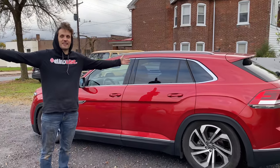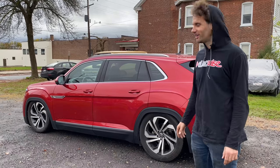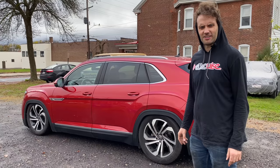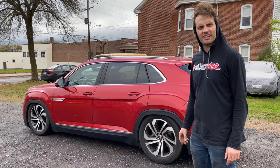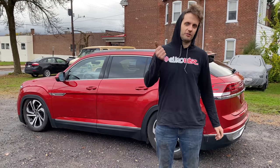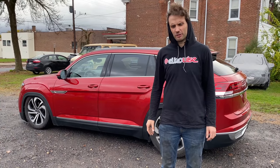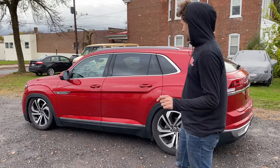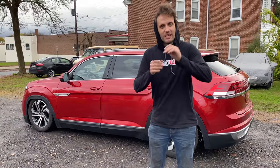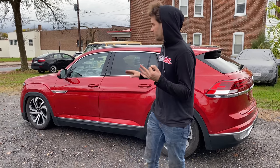There are other lowered Cross Sports out there, and as you know we have already lowered an Atlas, which looks sensational, but I would say this might be the lowest one — which is a very beautiful car. All we've done is make it dumber and harder to drive though. Just lowering your car doesn't make it cool or individual enough, so we're going to do some low-profile tires and wheels that are one and a half inches wider with an offset 15 millimeters lower. That's not going to help with the rubbing, but it's going to make it more challenging. Ralph's going to go home and start editing; I'm going to continue the work — wheels, tires, maybe some eight-piston brakes, some other things to make it nice and fancy.